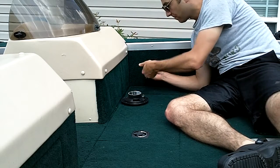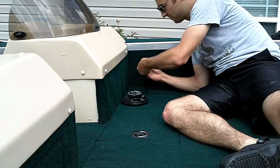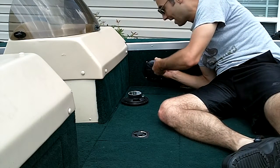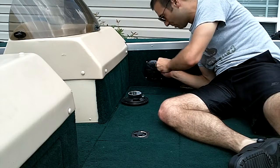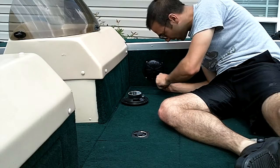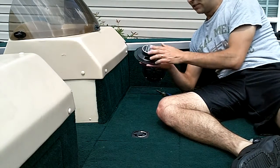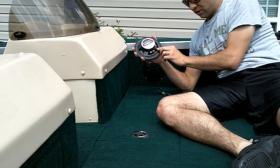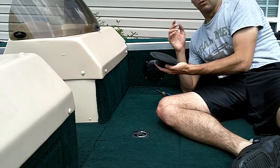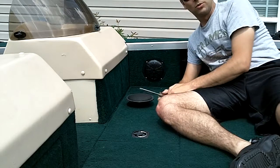These speakers I'm taking out — reading off the back — and now you can see it's a hot day because you can hear my air conditioners, plural, running in the background. The speaker we pulled out is from Advance. It's a 4-ohm impedance, and you can see it's a 30-watt max speaker, which means that 50-watt per channel from the CD player was really making these things sound pretty rough. I'm going to go ahead and install the other one, and then we'll test them out.